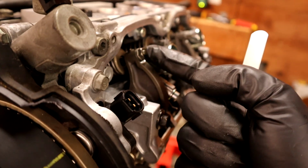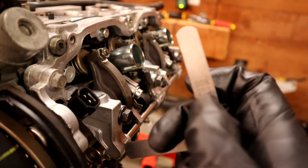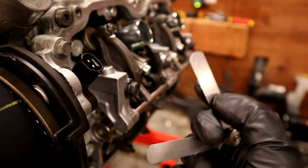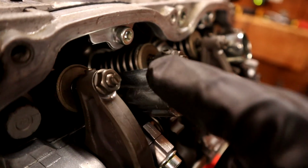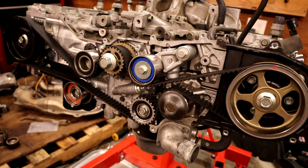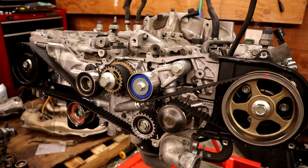And then in the intake valves, you take a little feeler gauge like this, and for these motors, the spec is 0.008 or 0.2 millimeters, and you shove the little feeler gauge in between the two pieces here. Let's see if I can. There's a couple pieces right in here. We shove the feeler gauge in there, and we make sure that we have that set appropriately. If we have to adjust it, then we adjust it by messing with these screws. So you put a little box end on this, unlock it, adjust your screw, and then lock it back down. So we need to go do that real quick, just sanity check all of our valves here because the machine shop said so. So we'll do that real quick, and then we'll get back to the build.